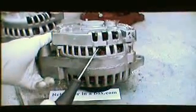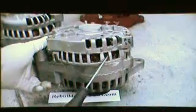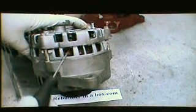On the smaller alternator there are two different versions: the 105 and the 110. If you look in the side you'll see groups of wires coming up from the winding going up to the rectifier. The 105 amp will have a single wire going up, and the 110 amp will have groups of two wires grouped together, rising up from the stator winding to the rectifier.